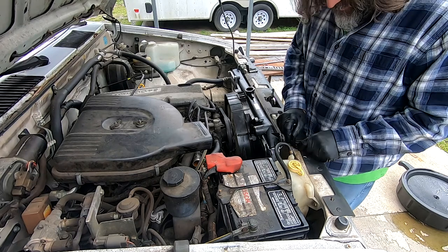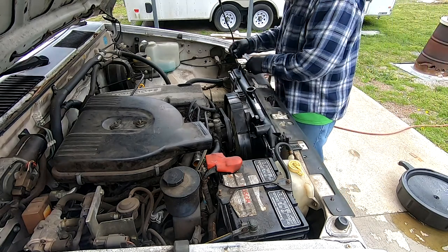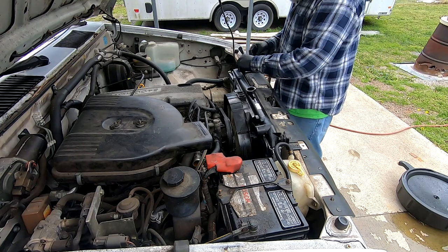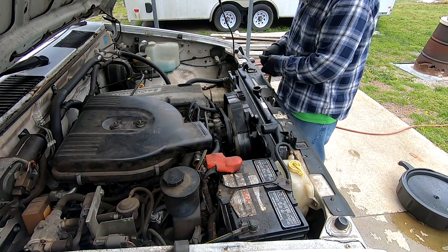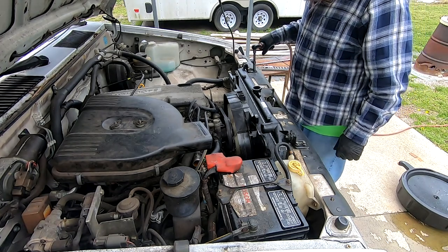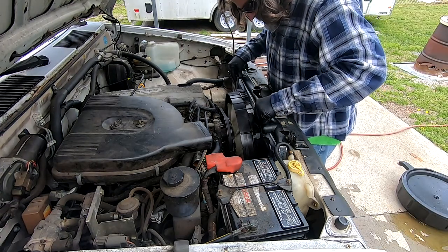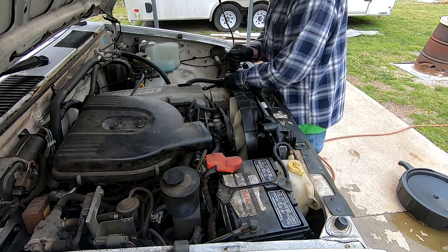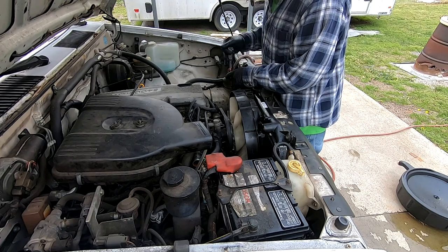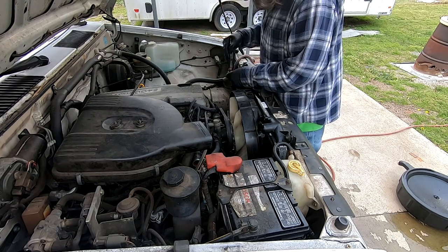All right, let's put these bolts back on. We're going to hand-start all the bolts and not tighten any of them down until they're all started — that way we know it's all going to fit together. Next we're going to put the shroud back on. You want to do these screws by hand because they're going into plastic and you don't want to tighten with an impact and have it break. Just get them snugged up so the part isn't moving, and that should be good enough.